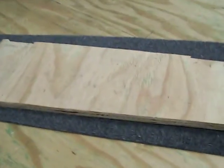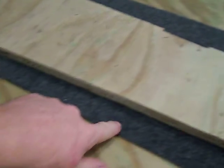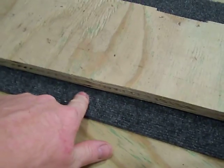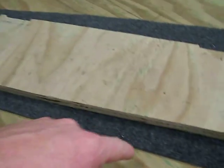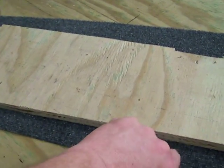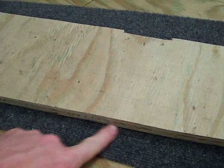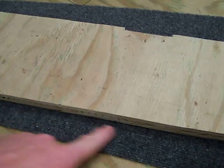Here's the other cover I have left to do in the back. All I do is cut the carpet to fit the size just a little over, put the 77 glue on here and on the back side of the carpet, lay it on there, get it on nice and tight, wrap it around the edges, take a stapler and staple it in, and cut the excess off. That's what's been working pretty good so far.